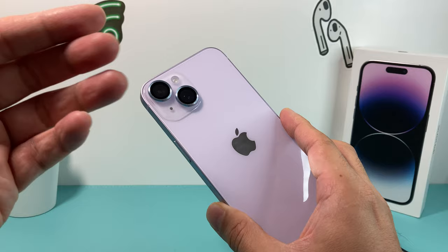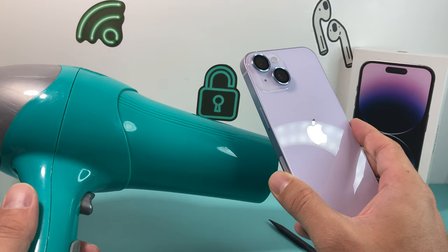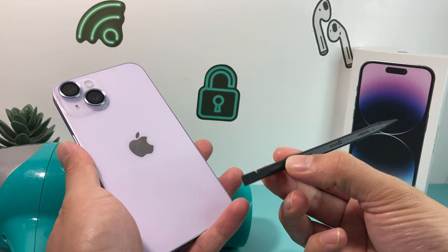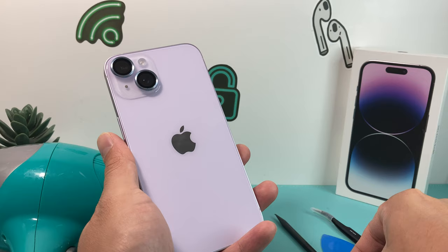So how can we loosen up that adhesive? Quite simple here. You don't need any special tool. You can take a hairdryer from your bathroom or in your house. And also, if you don't have a hairdryer, you can also use a heat gun if you have one. We basically want to apply very low heat to those lenses so that the adhesive becomes loose and we can simply use our hands or even a tool like this — something to pick at it, or maybe even a tweezer. These tools come from this iFixit kit — we'll leave the link in the description section. This isn't a sponsored video, but you can use those tools if you would like.